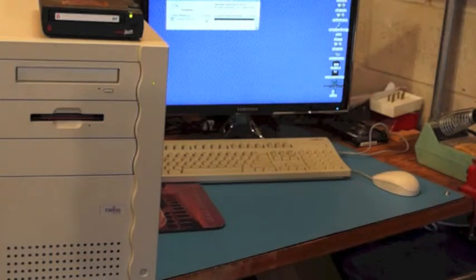I think somewhere around 7.2 they started to introduce the PowerPC code, which tended to bloat it up as far as hard disk is concerned. It wouldn't actually load it into memory. System 6 will run a lot quicker on the older Macs.